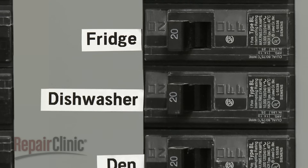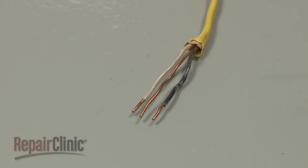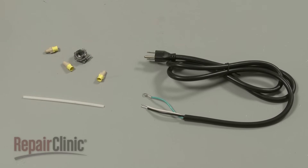Be aware that the electrical supply must be 120 volts at 60 hertz. A dedicated circuit is recommended. Using copper wiring only, the power supply line can be direct wired, or you can power the appliance through a UL listed power cord.